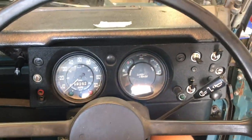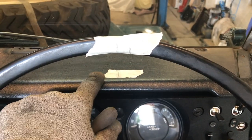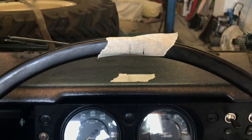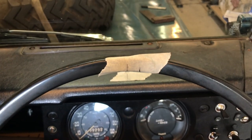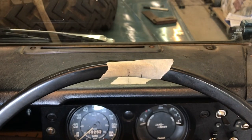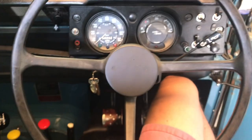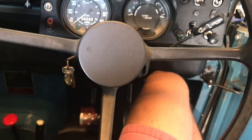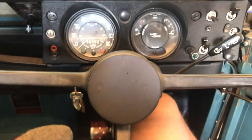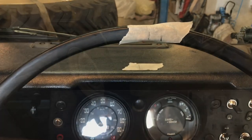A little bit Heath Robinson, but I made some marks on the steering wheel, took a right angle from the dashboard, made some marks so it stayed in the same place. You can see how far the steering wheel was out of centre — it's more than 10mm. So that's pretty much in line with the rest of the wheel and reference points on the dashboard now. Maybe I've gone a bit too far — I'll go back a little bit. Okay, so I've finished the steering.